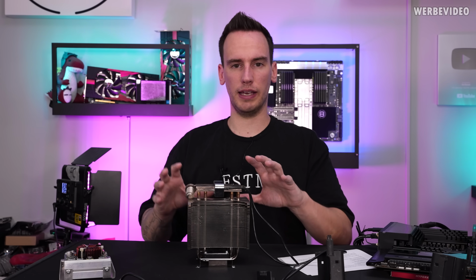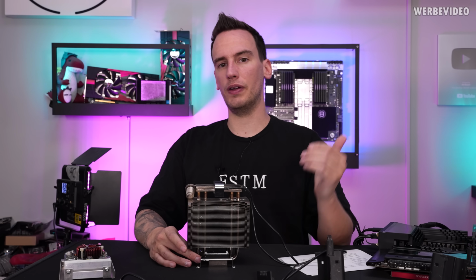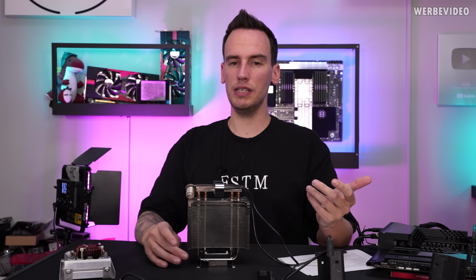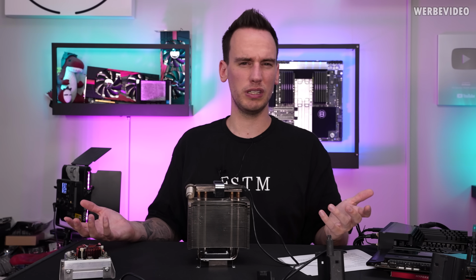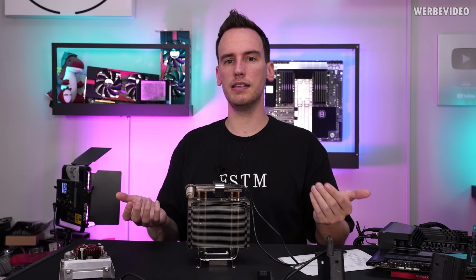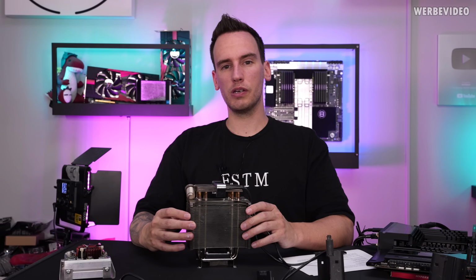But typically in this transporting heat scenario, it's the same with the water cooling loop. Water is superior because it has a very high heat capacity, not that high thermal conductivity, but that's not necessary, because thermal conductivity would describe the heat transfer within the material, which is something we don't really care about in this scenario, because we only want to remove the heat and take it up and not conduct it within the material. So yeah, the entire material choice is quite odd.